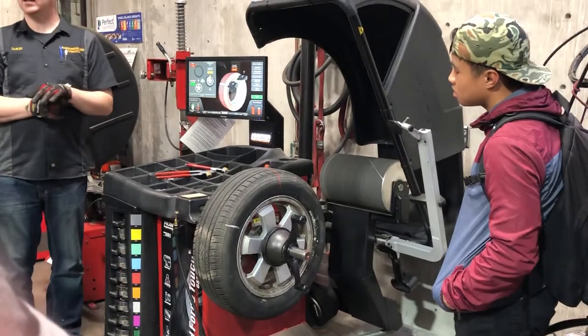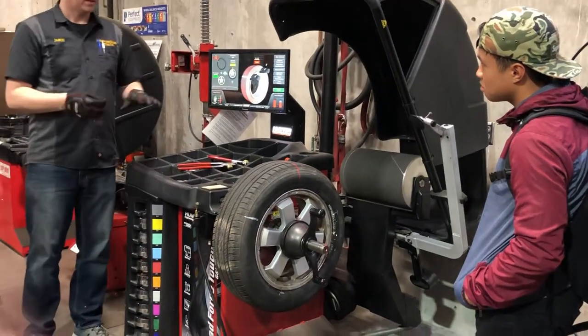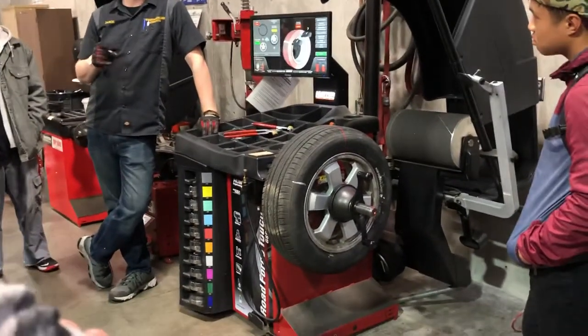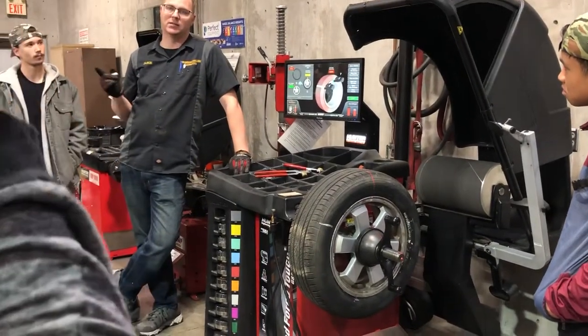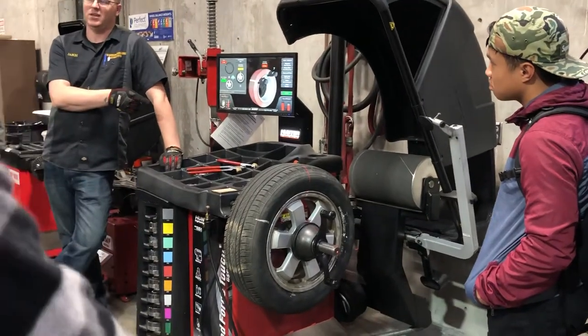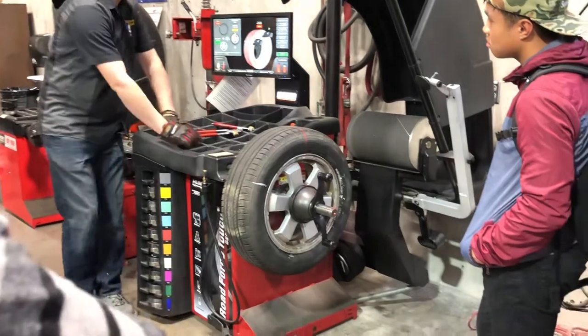Now, am I going to do that today? No, I'm not going to dismount again. Most cars and trucks you won't do this. But if you get something new with an unusually light alloy wheel — like some of the new Volkswagens — if you don't road force the tires when you put them on, you're going to get a vibration for every single one of them. Unhappy customers.